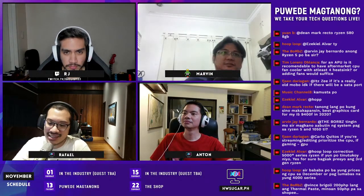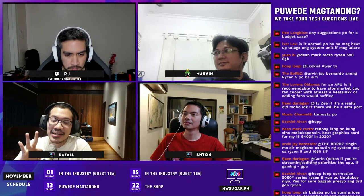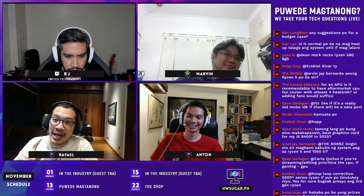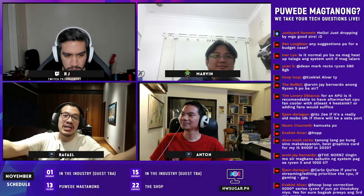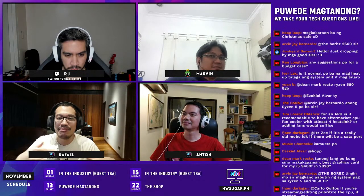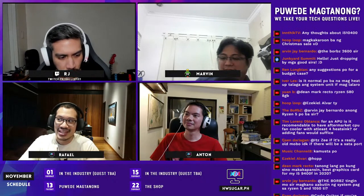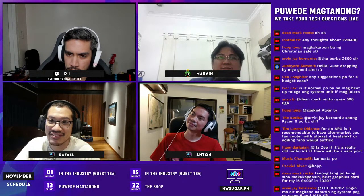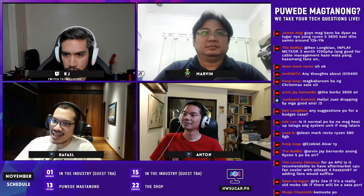Linus Tech Tips has an interesting video where he had three completely identical computers and left them running for one year in the same spot. One PC was completely positive pressure, so all five fans were bringing air in but none taking air out. The second PC was all negative, taking all air out but no new air in. The third was a combination, which is what everyone in the industry does, and what we do at Hardware Sugar. You have to have at least one exhaust fan and preferably three intake fans. In short, their conclusion is that the best way is a combination.